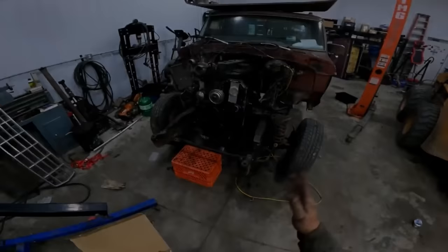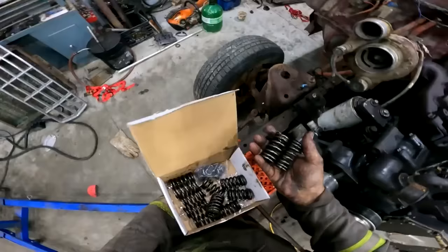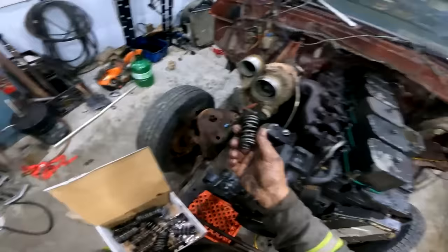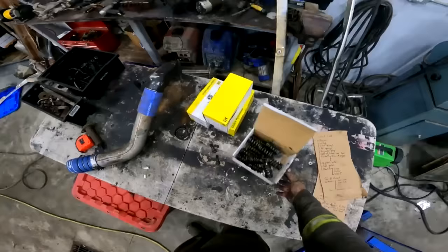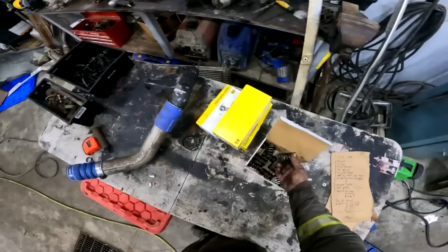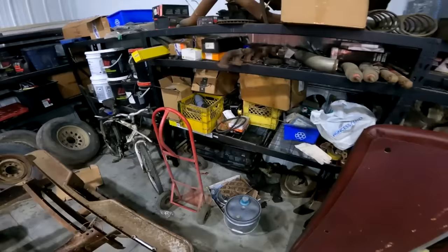All righty, so we're done all the valve springs, we're done the valve set. Go ahead and count all your old springs and make sure they're all the same. Because the last thing you want is some old stock spring in there with the other springs that are good for 4,000 RPM, and one that isn't. Valves don't like to party with pistons very much. But anyhow, we're on to the next step of this build, which is injectors.